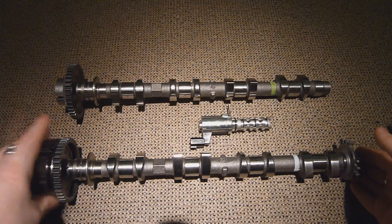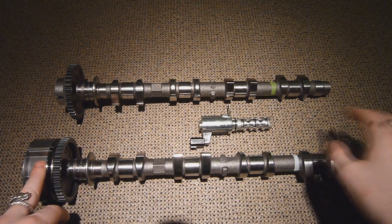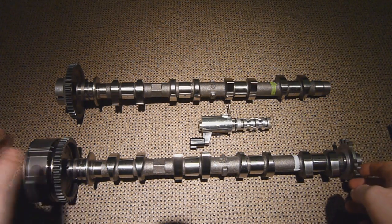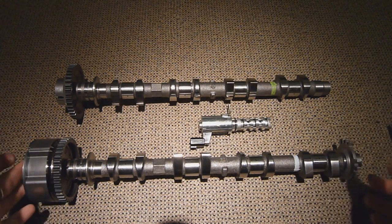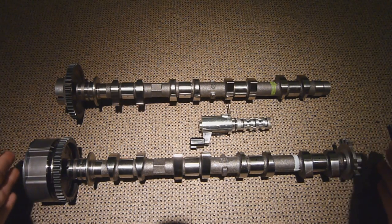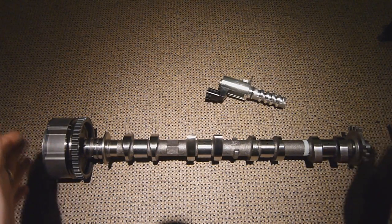Firstly we have this housing here which is actually the actuator, which is mounted onto the spur gear. The cam is actually mounted onto an internal stator which can actually move at varying angles in relation to the spur gear. At the right-hand side we have a cam positioning sensor, because as we vary the angle in relation to the spur gear, they have to keep track of that with these toothed gears. And that's basically the two differences, so we can take out the standard cam and look more at the variable cam system.